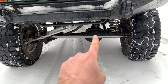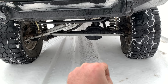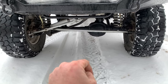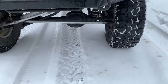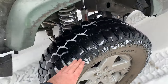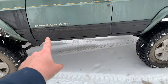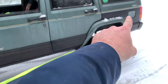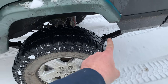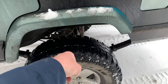This is from a Grand Cherokee. We got Rubicon Express five-and-a-half inch springs. We're running a factory track bar that's been extended and we're running disconnects. This bumper came on it — we picked these up for about 400 bucks. We did coat it with bed liner as you can see there, and we went with S10 add-a-leaf springs, so it's a bastard pack. We went with Rough Country braided lines.